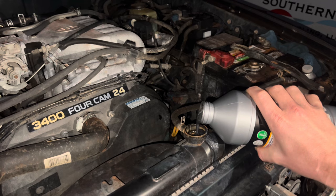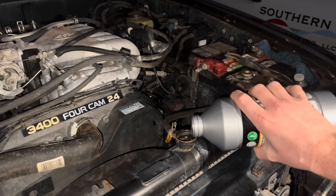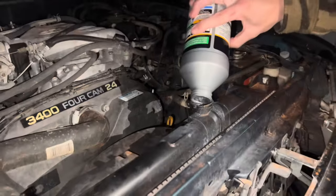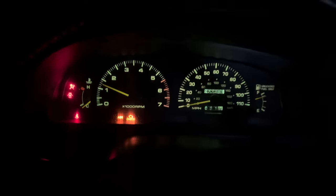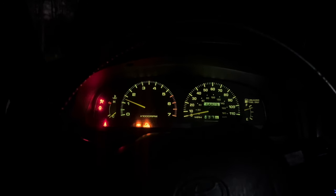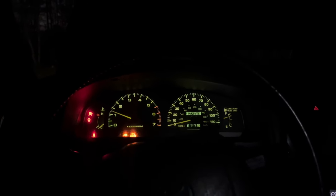We sealed the outside of the radiator up, had the heat on full blast, and now we have the car idling. It did throw a check engine light when all this started because it was having a bad misfire. We're going to let it idle until it gets to operating temperature, then shut it down and let it cool, top off the water if needed, go for a 15-minute drive, and hopefully get this sorted so we can go test out the front locker.